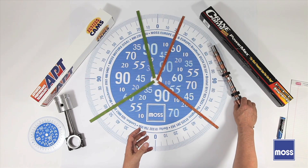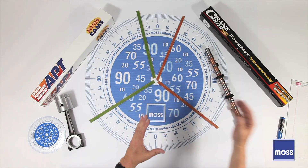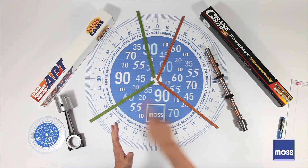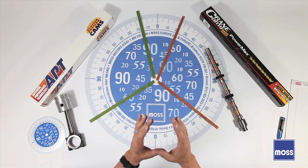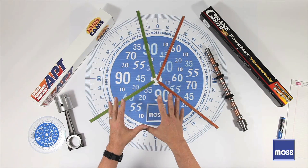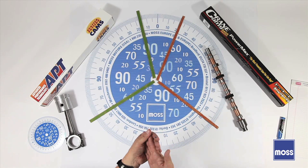When the car is operating at high RPMs, really spooling, we only have a moment for that intake valve to open, get the air in, and close. If we can open the valve more and push it down deeper — getting more lift from the cam — we can make the space where the air enters bigger and get more air in there. So at higher RPMs, that's a great thing.